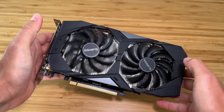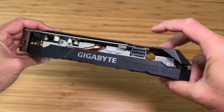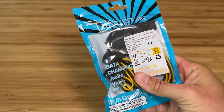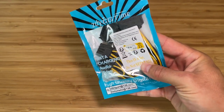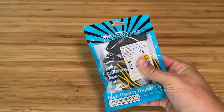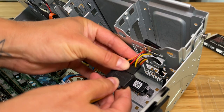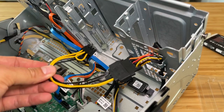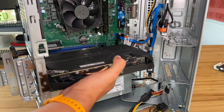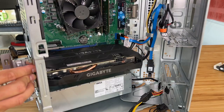There is an elephant in the room we need to address: the power supply. How am I going to power this GPU? Well, I'm going to use a SATA to 8-pin power adapter. I know you're all screaming 'don't do it' — but I've actually thought about this. The GPU and the rest of the system components do come under the 260 watts available. I'm also going to undervolt the card and reduce the core clock a little to get it running really power-efficiently, bringing it in at under 100 watts — the same as a stock GTX 1060 — and it should pair really nicely with the i5.